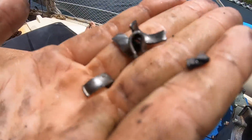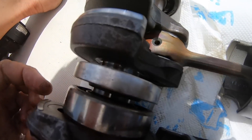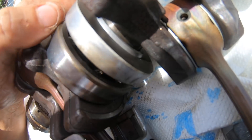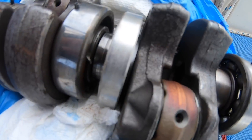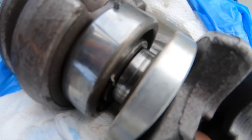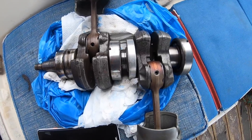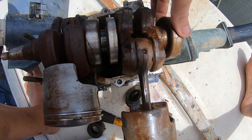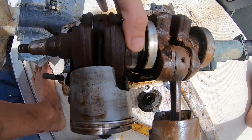The damage we see here is due to not properly mixing oil into the fuel, as this outboard was stolen in last year's episode, 'Where's My Dinghy?', and then finally recovered six weeks later in 'Operation Ridiculous.' I was not able to locate a machine shop here in the islands that could press the center bearing off of this crankshaft and properly put it back together balanced. So here's where it gets interesting — out of island necessity for a temporary solution, I will be pickling the rusty, not-so-trusty crankshaft from the outboard that was involved in the powerboat accident.